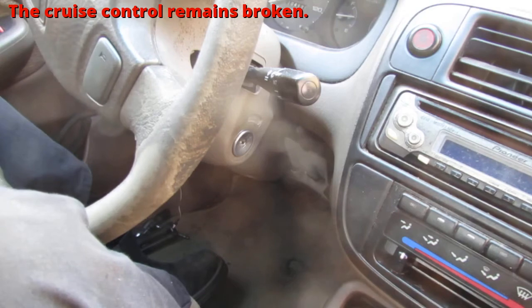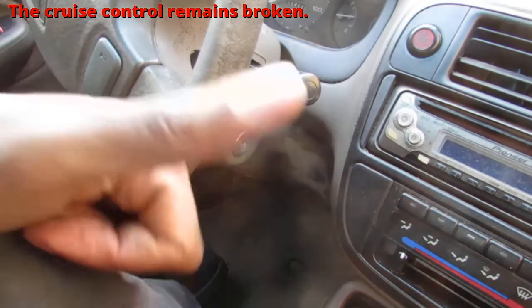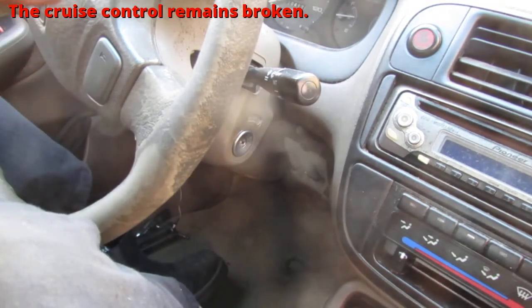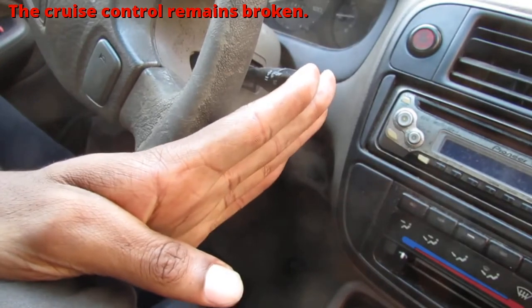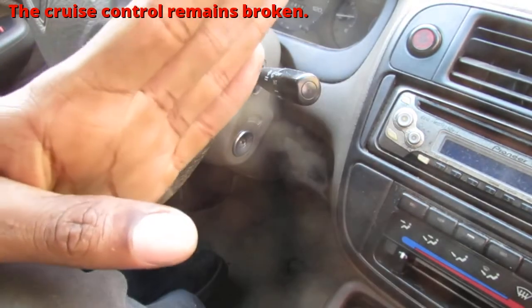And once you isolate those components, I showed you how to test them. If they test okay, then you just move on to looking at the wire integrity in between. But in general, break the system in half if you can. When you do it that way, it just minimizes how much you have to test.